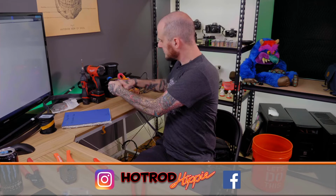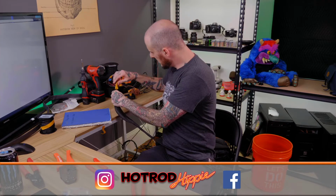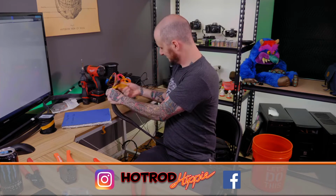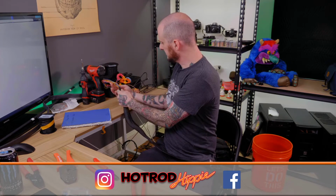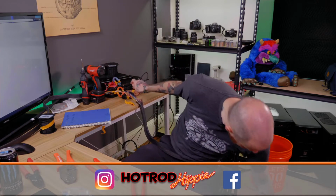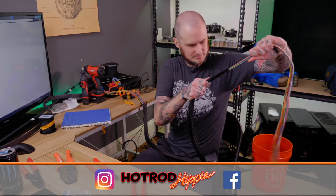So, all right. I've reached the end of my harness point here. So, I'm going to go ahead and take my tape off. Get off there. All right. Now I got to pull on the other end. The worst problem with this woven stuff is it gets a little crazy at the end. Unfortunately, they usually recommend you go ahead and use a lighter and burn the ends, but then I find it doesn't flare out as much, so double-edged sword on that.